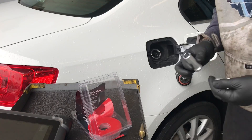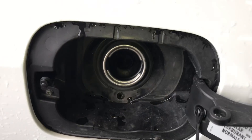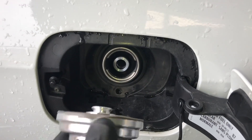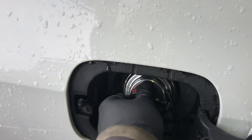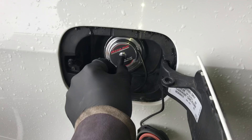This vehicle has a flapper door inside the fill neck, and the tool comes with a small tube that holds that door open so you can inject smoke. You put this hollow tube in so the smoke will flow through and go into the fuel tank. Then you take the Easy Evap, center it up with the fuel neck, press it on until it's nice and firm, and hook your smoke machine hose up to it.